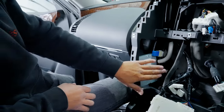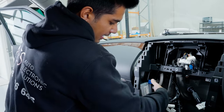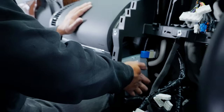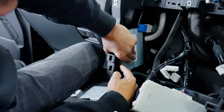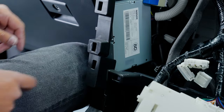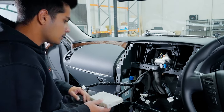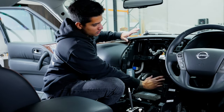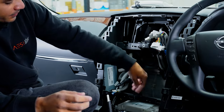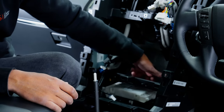It takes a bit of playing around, but you can get the climate module onto the side — go in behind and tuck it in. Use a big piece of double-sided tape and place it right in there; it'll sit in place, and you can even get it behind a little clip section of the dash to help hold it. For the other module, find a suitable location and use double-sided tape as well. Get all the main plugs brought up to the center section and keep that area as free as possible. The aircon control module is mounted with double-sided tape, but make sure to leave space for the speaker on that module so you can still hear it.